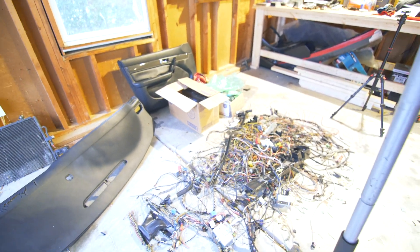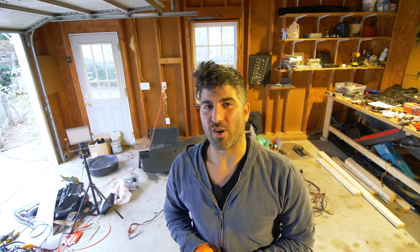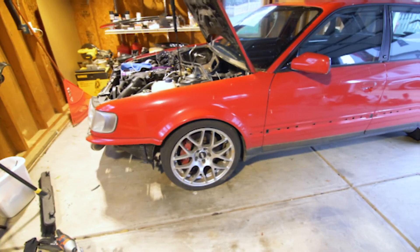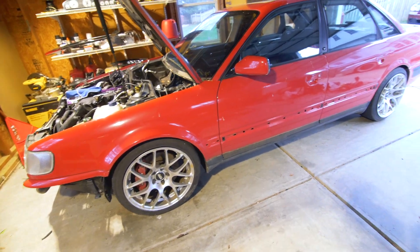We have a ton of work to do today, let's get started. For all of you guys that have German cars, you know how annoying it can be when you're reinstalling your wheels and have to line them up as well as ordering different sized lug bolts depending on your spacers. After owning Japanese cars I honestly definitely prefer using studs. This right here is a 78mm stud, so that gives us the ability to run up to 20mm spacers. First thing we're going to do is just raise the car and remove the wheels.